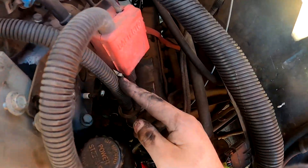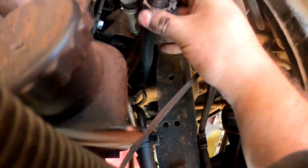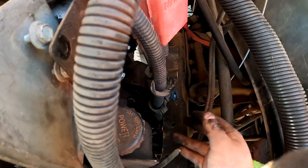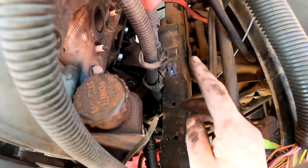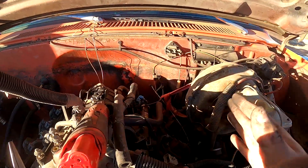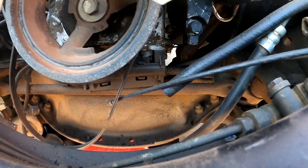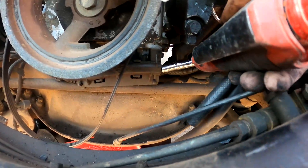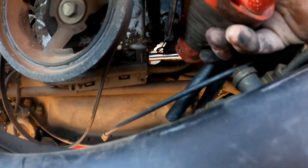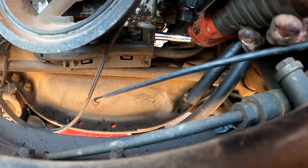Following the harness, you can see it goes underneath the engine — this one is usually the hardest to get to if you're pulling it from a stock vehicle, as it goes right underneath the oil pan. We're down looking at the front of the engine below, where the harness comes in under a plastic cover that wraps around the oil pan. On the right side you'll see a 10mm bolt — go ahead and take that off.